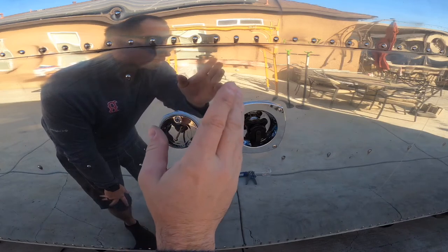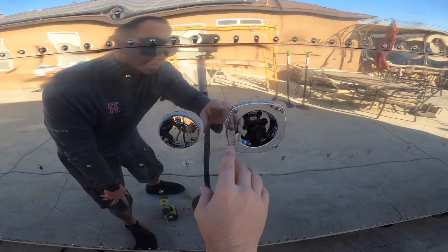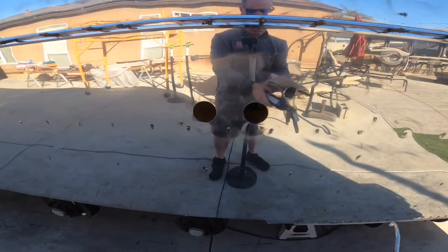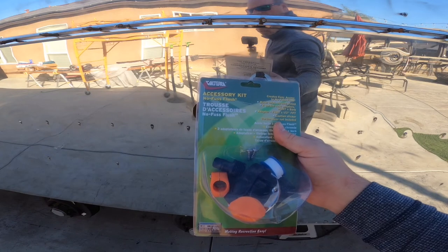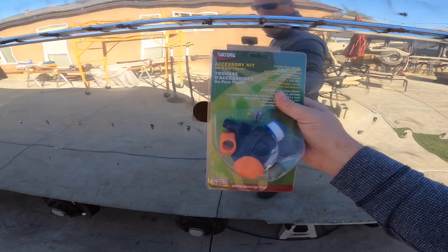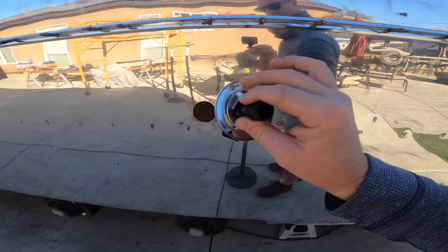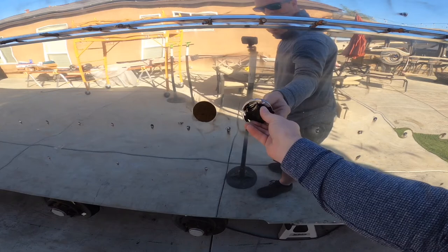And then I'll show you a cleaner way to do a backup seal on top of this, which we're going to do anyways. So with that, we'll go ahead and continue on with the next plumbing parts. All right, next ones are gonna be the no flush valves for the two grey tanks. Same thing like we just did on the freshwater valves. SikaFlex on the back seal. That's what those look like. Put some SikaFlex on the backside, two screws. Mount just like that.